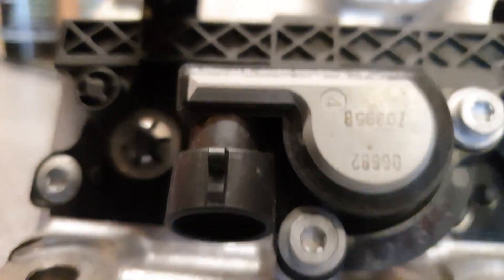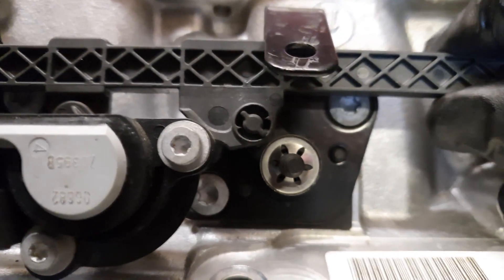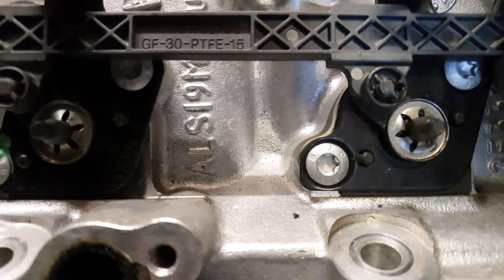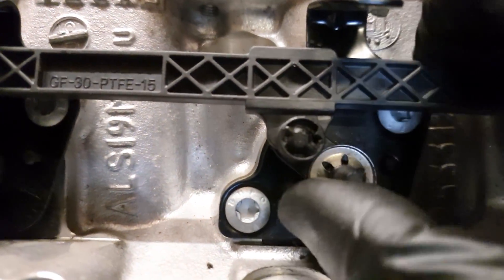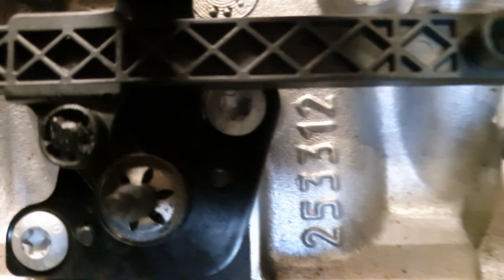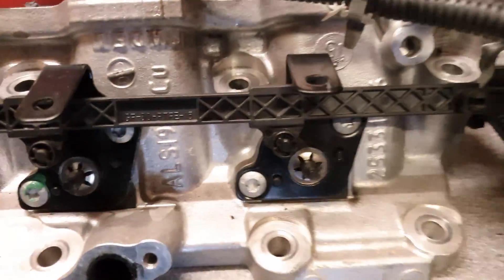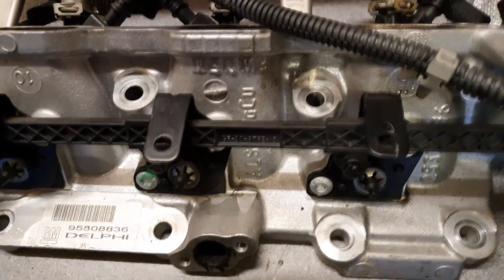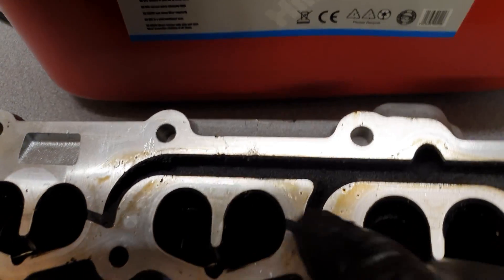What happens is these little bearings wear out and these flaps can rattle, and the whole bar can rattle. I could feel this when it was on the car. If I wiggle these about — starting up at this end, no movement there, nothing there either, a little bit there — and when you get to this one you can see there's a lot of play in that. If you look very closely you can see there's damage: this plastic bit inside is worn away. The rattle seems a little bit too extreme for that to be the only cause.